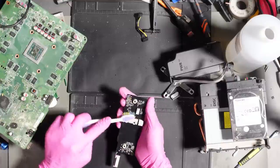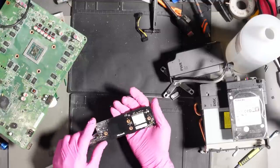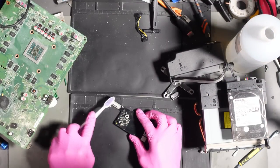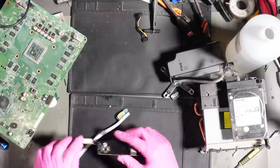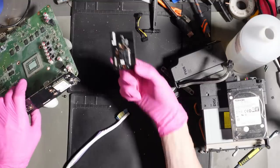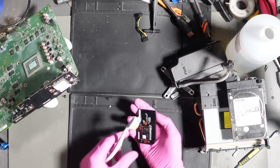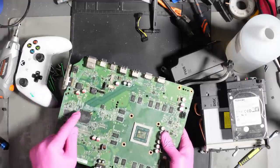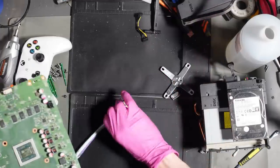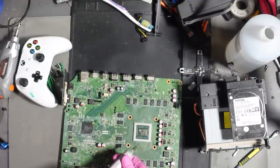I'll clean both sides and also the connector as well. I'll pop that in there. And the same goes for the Wi-Fi card — I'm going to give it a scrub with IPA even though I can't see any corrosion. If that doesn't fix it I'll replace panels if I have to. So we're going to get a little bit of white staining but that's isopropyl alcohol more than anything — I wouldn't worry about that. We're going to put some of the best thermal paste that money can buy on this and then it's going to work absolutely perfectly.